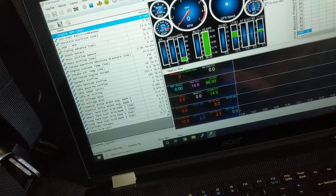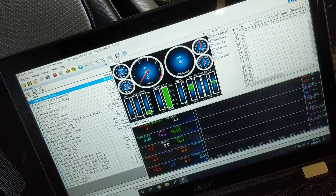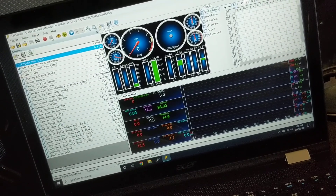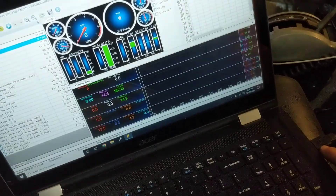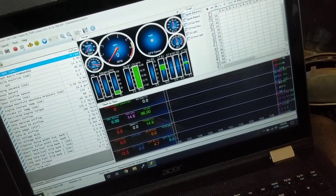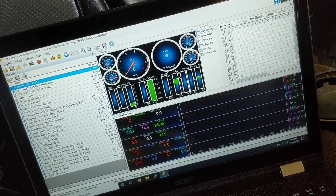It kept disappearing because I assumed the pins on the adapter I bought would be correct, but they're different when mirroring across to your USB cable — so you have to pay attention to that. Secondly, restarting the computer with the cable plugged in makes a drastic difference. After you restart with it plugged in, it works over and over again without restarting. If you leave it plugged in and use a different USB port for flashing, you can go from flash back to scanning. Hope that helps — leave a comment if you have questions.